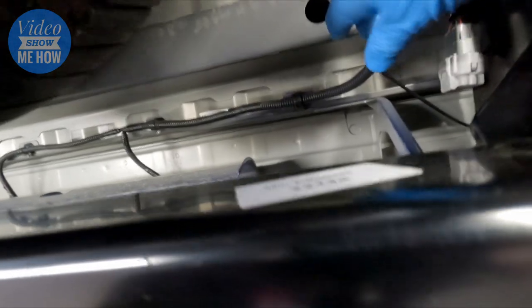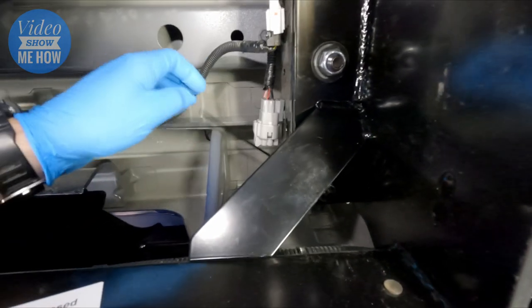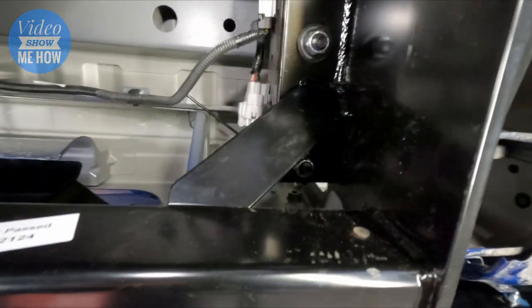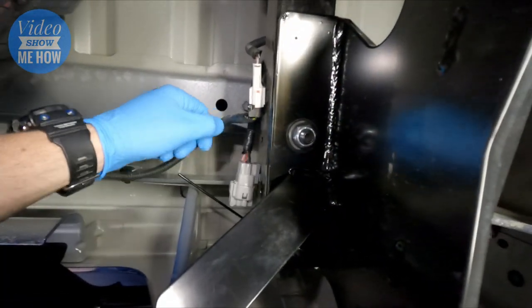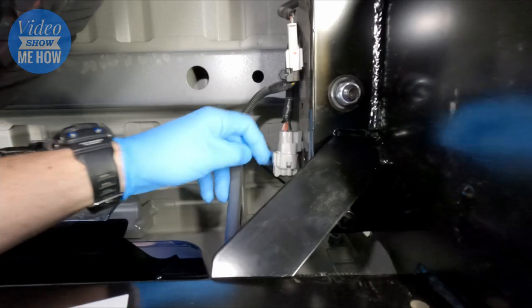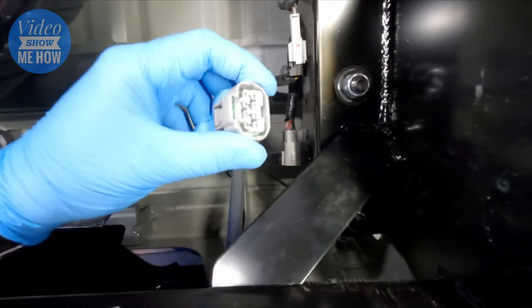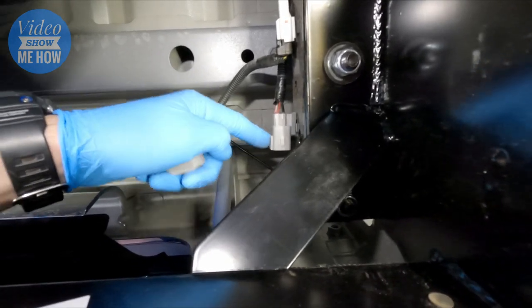I think that's okay though - there are plenty of spots where we can get this up out of the way. The next step is to locate the factory loom that is ready to accept any trailer modifications, and that is this here. I'm under the left-hand side of the tub. You can see, other than the TJM gear, this is the loom right here. It has a little protecting cap on the end just to cap it off. It's a matter of removing said cap, which is just a push and pull scenario - and look at that, you can even do it one-handed. That's what we want to connect to.